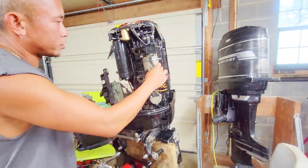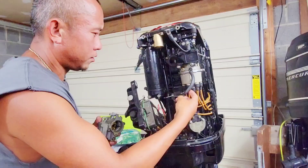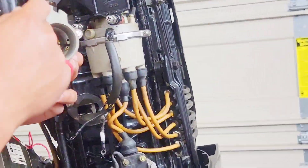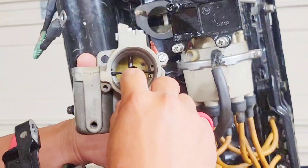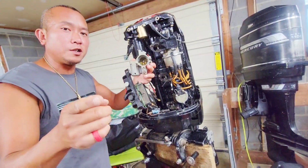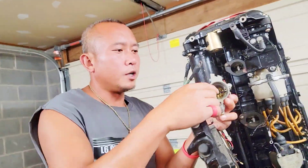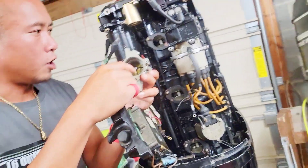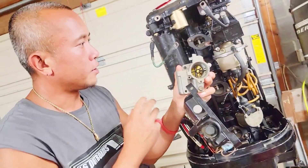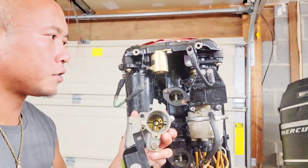I do have to fix the stator wires — the trigger is good, but the stator wires are just bad. Someone decided to put liquid electrical tape on them and it's just not working for me. So I'm going to take all these off and rewire this whole distributor, install these carbs with the proper setting so the fuel just stops right there and you see the fuel in the actual venturi. I'm going to leave the face plates off so you can actually see. This 1500 is very healthy — over 150 PSI on all six cylinders. So the plan is: install the carbs, fix the wires, and that's where we're at.